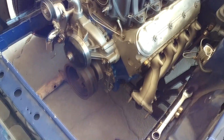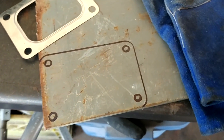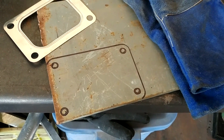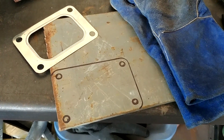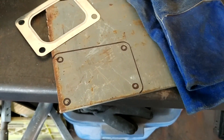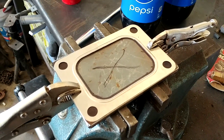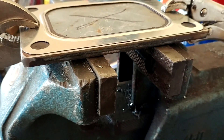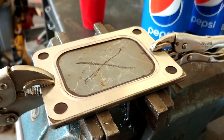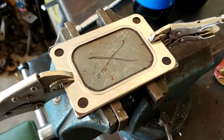I'm waiting for the bends to get here, which should be next weekend, and then we'll be able to make a lot more progress. While I'm waiting for the hot side bends and pipes, I'm going to make the T6 flange that the pipes are going to be welded into and the bottom of the turbo mount. I traced that out and I'm going to cut it out. I've got the basic shape of the T6 flange cut out — did it with the chop saw, blew the breaker like nine times. This material is pretty thick. I'm ready to punch some holes and start cutting out the middle, but first — lunchtime.